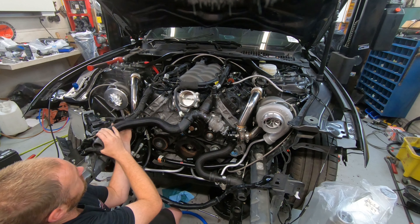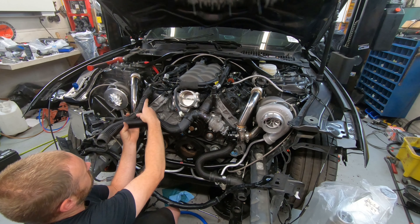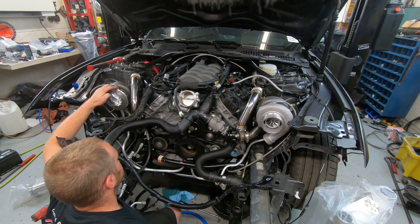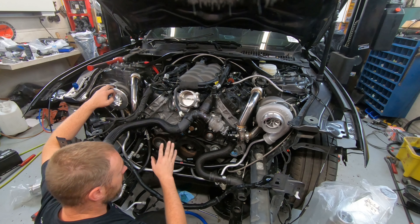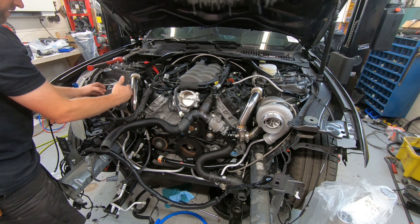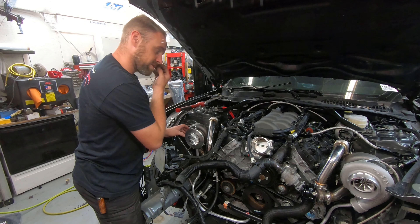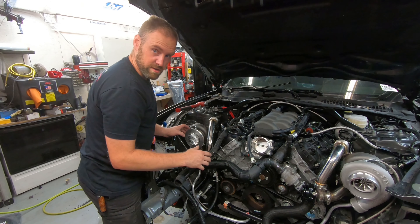I also have radiator hoses in here now. I'm a little concerned about this spot — once the radiator's in, this hose is going to be against that. I might have to cut this hose shorter just so I can pull it away and clamp it to keep it off of there. I'm going to rotate my zip ties — but I definitely have to find some way to keep that off of there. Also, if you're working on this with blades exposed, be extremely cautious not to bump them — they are very easy to bend. If you nick one, it's game over. I'm going to throw the other housing on here and throw a couple bolts in just enough to hold it in place so nothing accidentally drops on it.